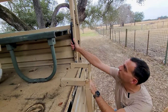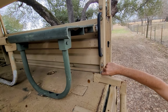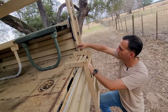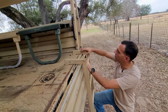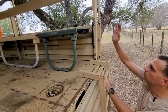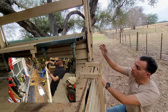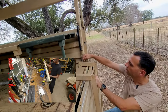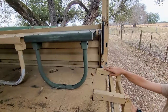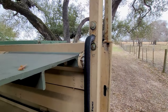So I changed the way this handle is mounted on this troop seat piece. Normally they're attached with this awkward large nut that has a hollow in it so you can get at the flathead piece. It made it really hard to get a big screwdriver in there, and it was a nightmare getting this piece off. So I drilled some holes, used rivet nuts, and just bolted it directly to this piece. It doesn't obstruct anything really, and it made it so I could use standard hardware when I replaced all the hardware. I also used my Dremel and redid some of the flathead pieces and neatened it up, with new washers. It made reassembling all this much better all the way around, and I learned a better way to go about doing it.